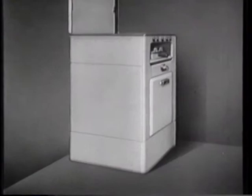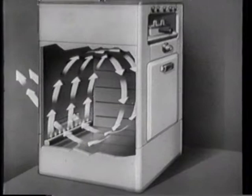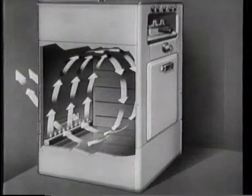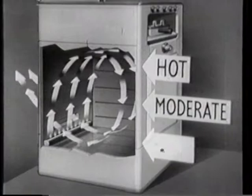This is what is happening inside the oven. The heat from the burners causes hot air to rise to the top, where it is deflected by the roof of the oven and forced down again, so that it goes out at the flues. This means that there is a continuous circulation of heat inside the oven, and also that there is a difference of temperature between the top, the middle, and the bottom. Since hot air rises, the top is hottest of all. The middle of the oven has less heat by comparison, and the bottom has less heat still — we call this the cool part of the oven.